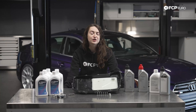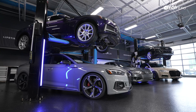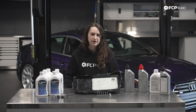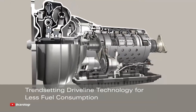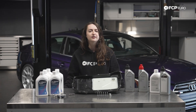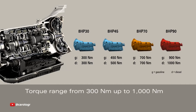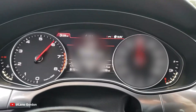Let's go over the transmission and driveline guide for the Audi B9 platform. The Audi B9 platform was initially introduced in 2017 for the U.S., and it offers a variety of transmission options depending on the model and drivetrain configuration. Most notably, the performance-oriented S4 and S5 models are exclusively equipped with a traditional automatic, the ZF8HP. This is a torque converter-based automatic, and it replaces the dual-clutch many have come to know and love in the B8.5 S4 and S5, and it was chosen due to higher torque capacity to support the EA 839 engine. The ZF8HP also offers quick, crisp shifts and adaptive programming, making it versatile for both spirited driving and comfort-focused cruising.